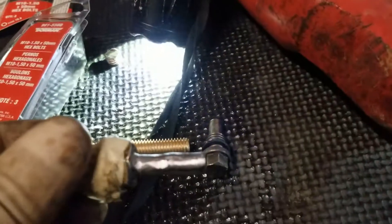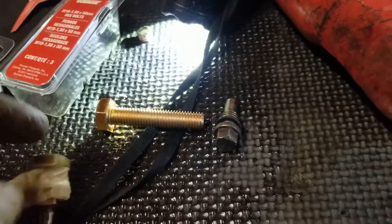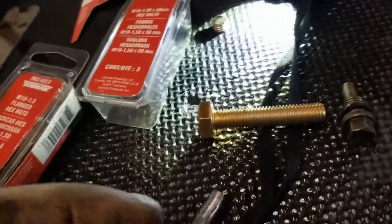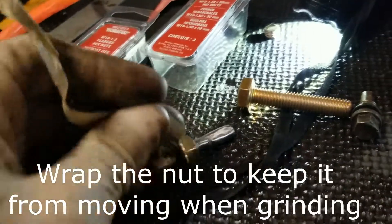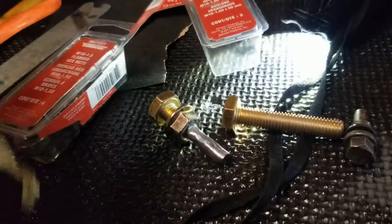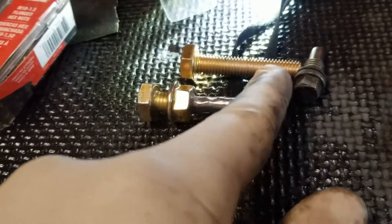This is my special tool. What I did here is I first measured it to see what I needed — I measured it on the iron block, not on that ugly block, but the one outside, just to double-check the length I needed. You can also go on the website and find the measurements. I put a bolt all the way up here to protect these threads, and I put a piece of tape as far down as where I wanted the threads to cut off.